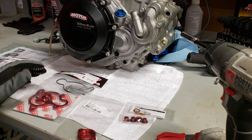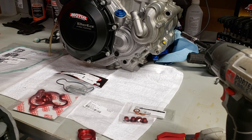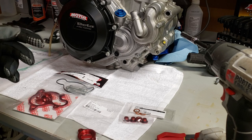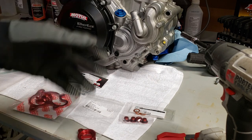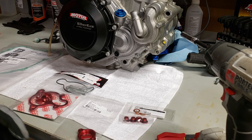After we're completed we'll put fresh oil in. I usually flush the engine — I'll pour a few ounces of oil in with the plugs out on the transmission side so it knocks any remaining debris out.